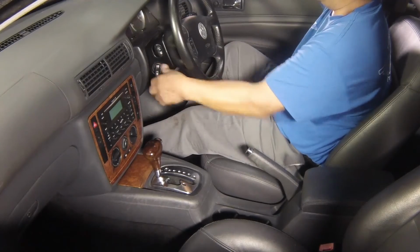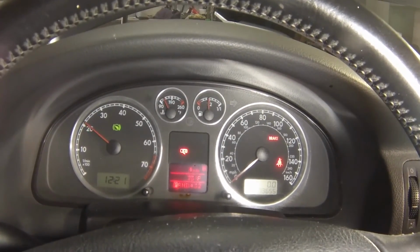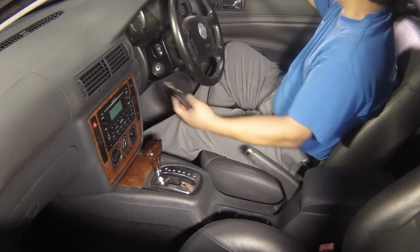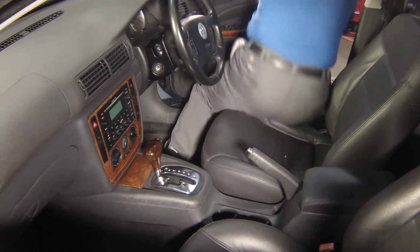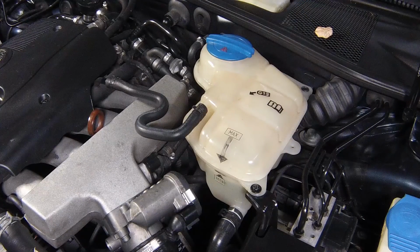Start the engine and run it at a fast idle for about 3 minutes. After this, allow the engine to idle normally until the bottom hose becomes hot. Check for leaks, particularly around disturbed components. Check the coolant level in the expansion tank and top up if necessary. Note that the system must be cold before an accurate level is indicated in the expansion tank. Never remove the cap when the engine is still hot.